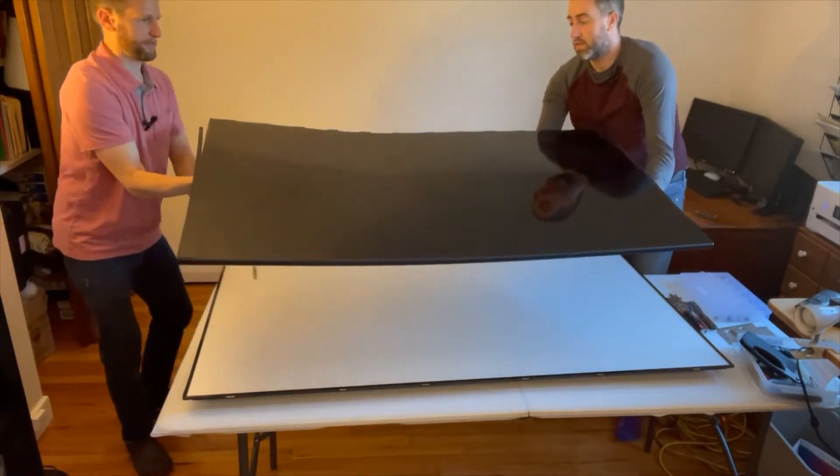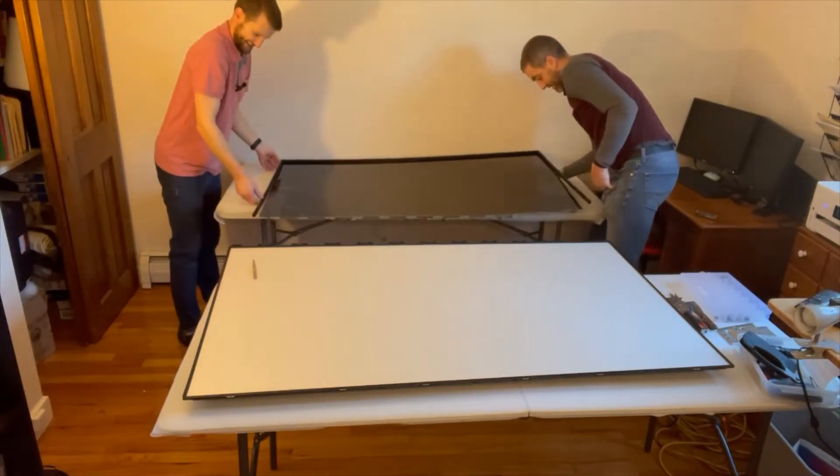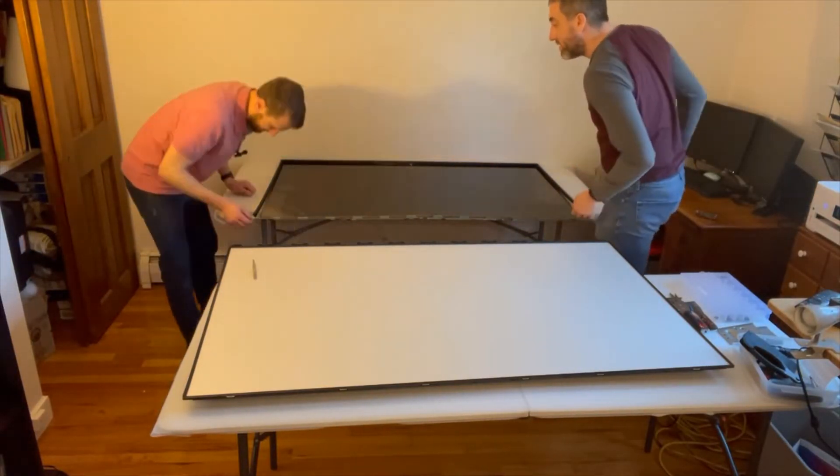Here we've got the LCD fully removed. We flip it over and put it aside for storage. You can see in the corner where some of it's peeling up. We shine a desk lamp underneath the LCD and you can see light coming through on this video, which looks purplish-pink. In real life, almost no light is visible — it's very pale. The iPhone camera is likely picking up some infrared light. With a loupe, we can zoom in closer at the pixels and see that these are closed pixels but light is still getting through, showing how LCD pixels are imperfect.